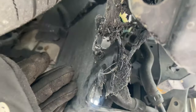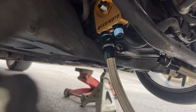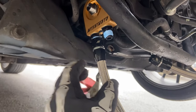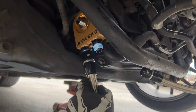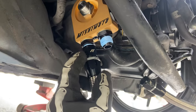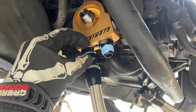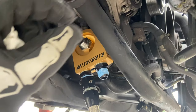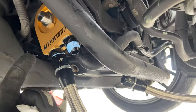Alright, we got a problem — fifty bucks wasted. On the actual G35 and 350Z, the oil cooler fitting comes from the side. Everything is the same: the lines, the sizing — the only thing that's different is it's a 90-degree angle so the hoses can go up top or higher. But this one is going to be scraping the floor, so I can't use that.